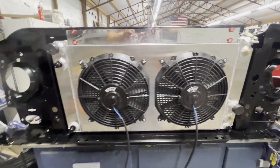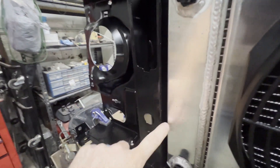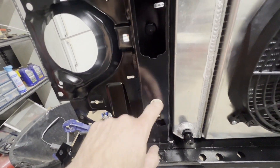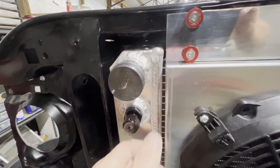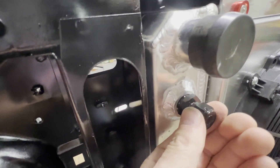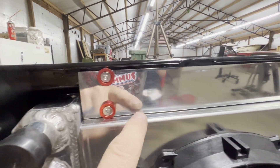We got it back out of the truck. I wanted to show you some things you couldn't see in the truck. This is where I welded back in the piece I cut out — this is on the driver's side, and I chose the driver's side because it was much wider. I narrowed it up, and it looks almost identical to the passenger side, but still gives you enough clearance when you drop your body mount bolts in. These are M20 by 1.5. If you could find just a plug, it'd be much cheaper than using an M20 by 1.5 by 6AN with a cap — that's an expensive block-off plug.